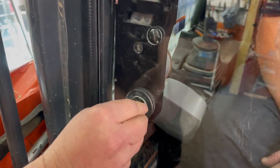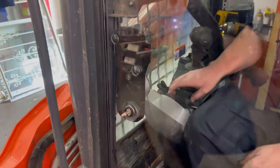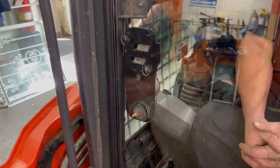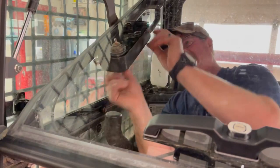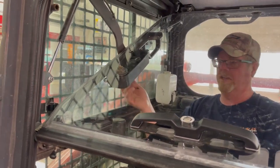We're showing this because ours was broken and already disconnected, so we're demonstrating how to put it back together for those who don't have the ability to take it off the glass. The nut is a 7/8ths deep socket — you can pretty much just hand-tighten it. Then your little boot goes on, then the wiper blade. The plastic cover just clamps on and snaps into place. Usually put one side first and then snap the other side in. The wires just go in the guide and stay right down the side.